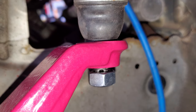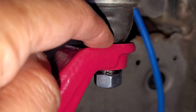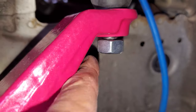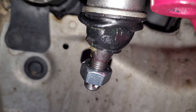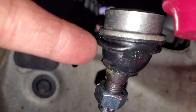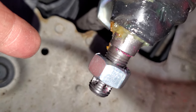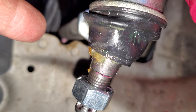On the left side, the aftermarket hole for the tie rod end is a little smaller than OEM, so I had to use a Dremel to open it up enough for the nut to fit through. I need to torque it down tomorrow and put some grease around it. When I did the right side first I didn't know the hole was too small, so I was forcing it in. When I tried to remove it from the left side, I burst grease inside the boot — so this tie rod end boot is basically done. I'll probably need to get a new one, so there'll be a slight delay.